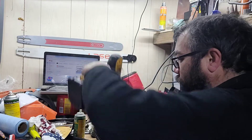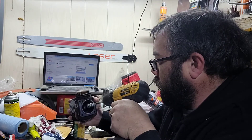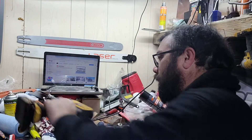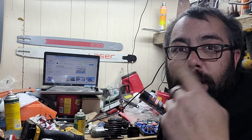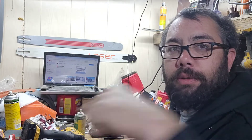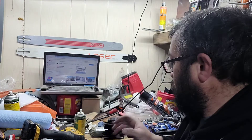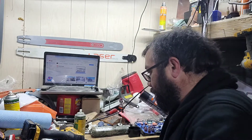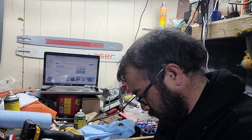I'm not going to say this is going to be salvageable — it may or may not be, I don't know. You've got to be very careful with these things. I only give it two passes at a time going up and down, just because the plating is so light. Cylinders in general you've got to be careful with.